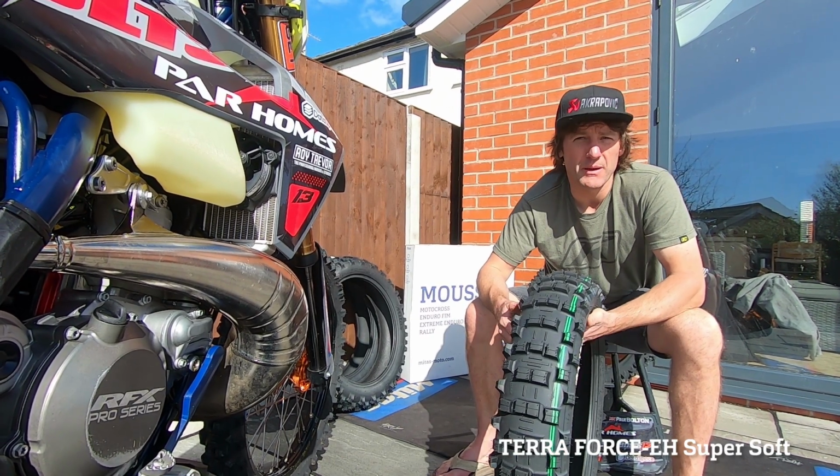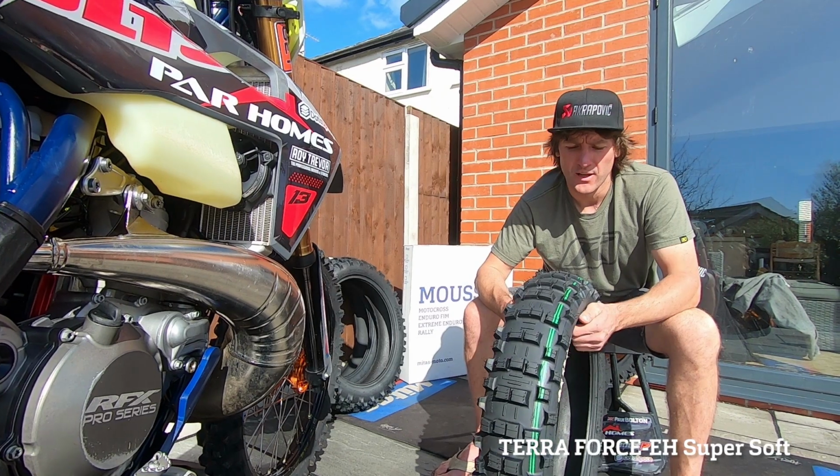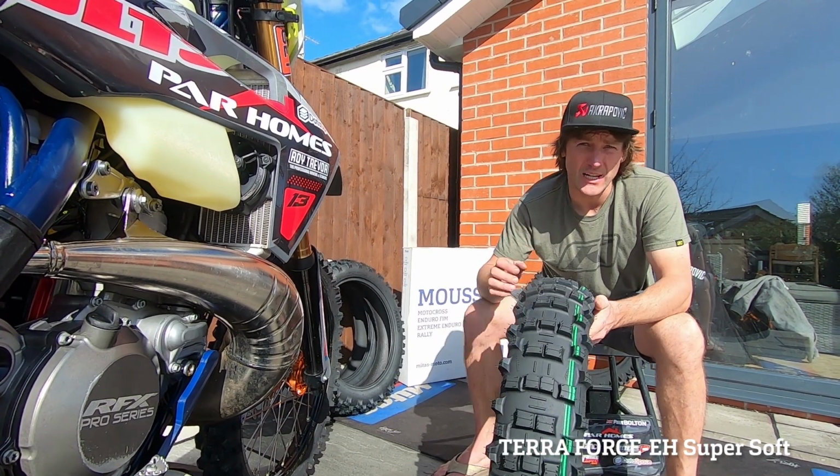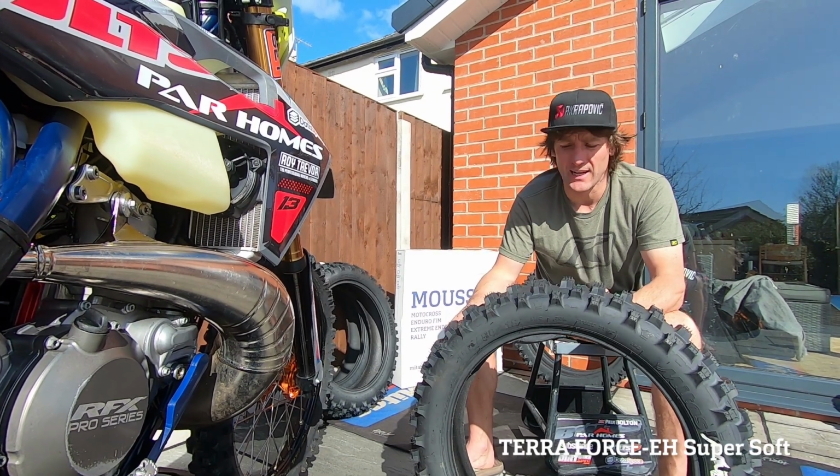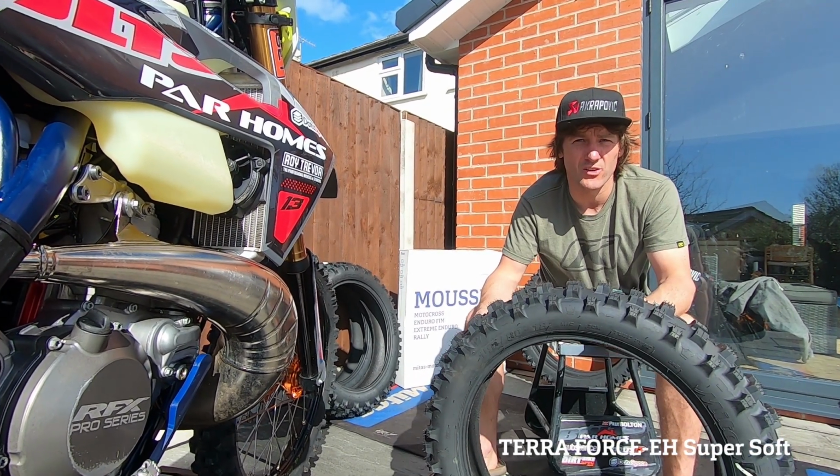When I talk about bedding, I mean just go riding, do normal stuff, and just try to break in that mousse. So when it's ready, when you're coming up to a big race, you get it out of the bag and you're straight into the tyre knowing what it's done.